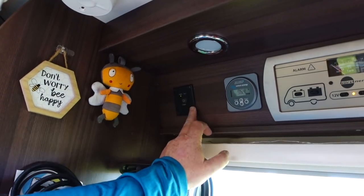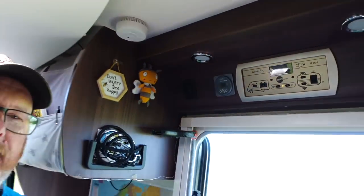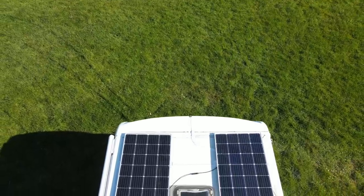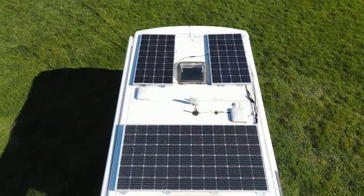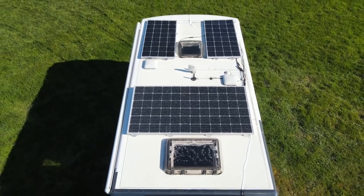That switches the inverter on and off. When we switch the inverter on, we've got a special automatic system which makes every 230 volt socket in the van switch to the inverter, and if we're on hookup it automatically turns all the sockets over to the hookup and not the inverter. We can also run the hot water and heating all off electric — all off the power of the sun. We've got 660 watts of solar on the roof. At most we've had 42 amps so far, but it's only early April so hopefully we'll get 50 amps, which is the maximum of the controller.